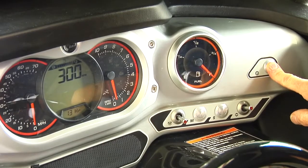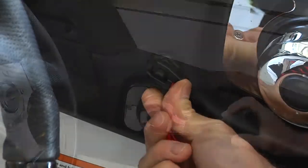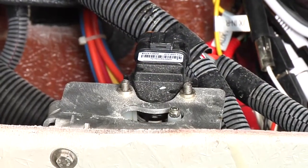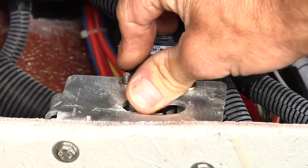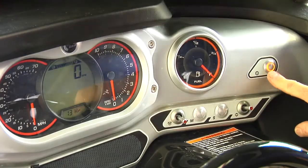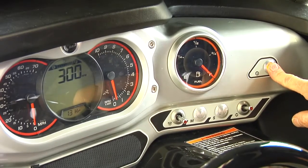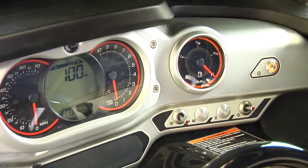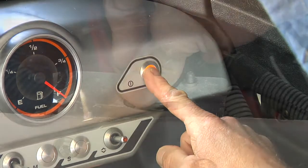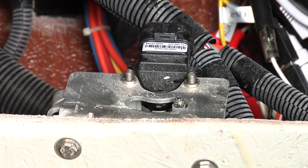To activate Drowned mode, make sure the engine is off and install the tether cord on the engine cutoff switch. Make sure the throttle shift lever is in the neutral position. Have an assistant move the throttle position sensor to the wide open throttle position and hold it in this position. The ECM will allow engine cranking while preventing fuel injection and ignition operation. Do not crank the engine for more than 10 seconds. Crank the engine to distribute the oil onto the walls of the cylinders. Release the throttle position sensor to allow the ECM to return to normal operation mode.